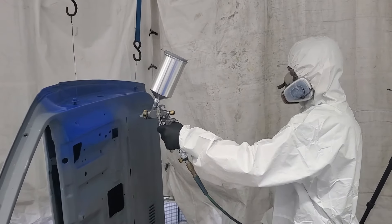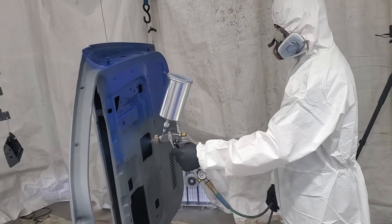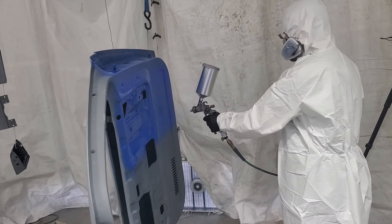As soon as parts are thrown all over the place, that's going to be harder to do. I think I'm going to pull the doors off. I've never painted an assembled car — I've always taken everything off and painted it bare. While I'd love to do that here, I'm not convinced the juice is worth the squeeze. So probably I'll paint this one assembled: take the doors off, fenders off, hood off, rear hatch off, all of the weather stripping, paint things mostly in pieces, then put everything back together for the final clear coat — maybe the final color coat as well.